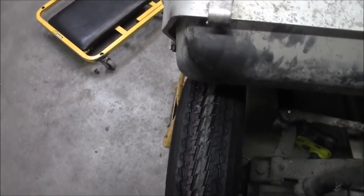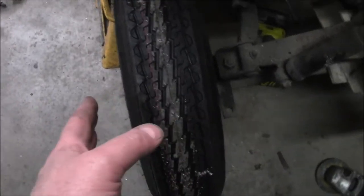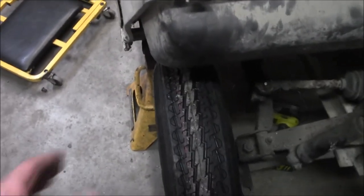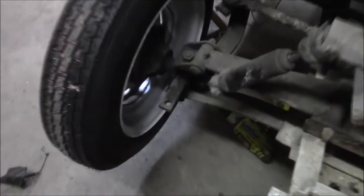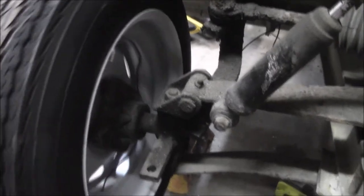we want to space these guys out further. And you can buy wheel spacers on eBay or Amazon, whatever. It just takes the wheel and spaces it out 2 inches or whatever. But the only problem with that is your steering, your wheel is swinging more and it wants to hit up inside. So I might do things a little differently, like I always do, to keep the steering geometry the same.